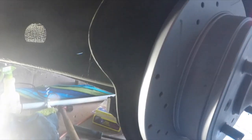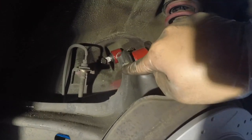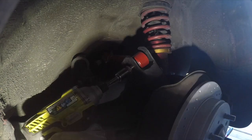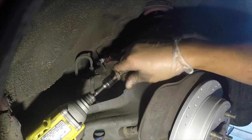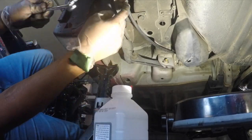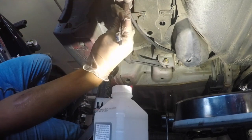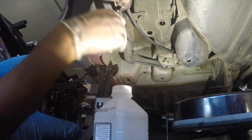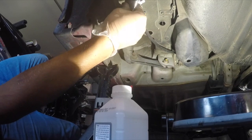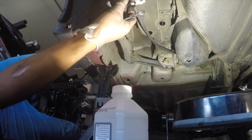And be sure to jack up the lower control arm so that this is holding. Everything is gonna drop, okay? So let's take this out, but jack up the lower control arm. Okay, up top, like I said, either these two or this. So I'm gonna go with this one for me. Forgot I had this. Should have done that in the first place. The cable bolt right here. So we're gonna take that out, move that out the way temporarily so we don't damage it. Okay, remove that. We'll put the bolt back so I don't misplace it. Okay, so let it hang.